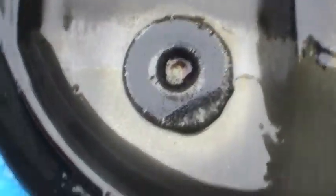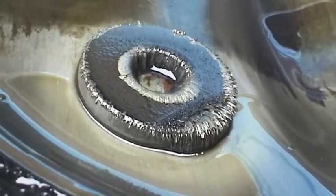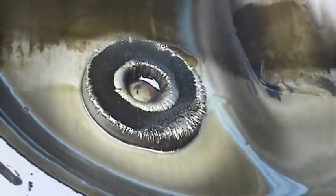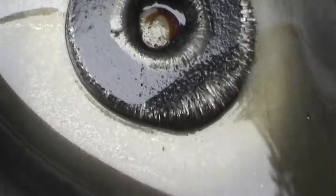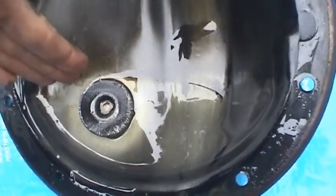And that's really good engineering right there. I'm very impressed with that. I don't see that on the Ford 8.8. And looking at that magnet, it does look like it never has been cleaned. And there's not really a whole lot of buildup on there of iron particles or anything. A little bit of particles down in there. You can see where the fluid line was, right about there. But there's not a lot of buildup on this thing for 18 or 19 years and 113,000 miles.